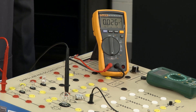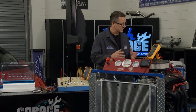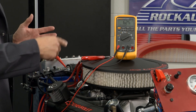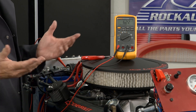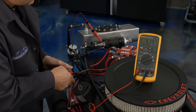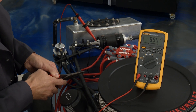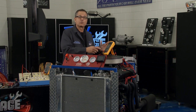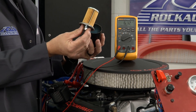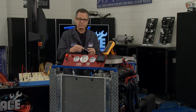If I reach down and try to stop that motor, it starts to make a higher amp draw. That's important when you start working on your car with components that have mechanical resistance. I can demonstrate it with this fuel pump. If I hook it up with my meter in series, the electrons are running through — we're looking at 6.24 amps, that's fine. But if I pinch this fuel line, watch that amp draw go up — it starts blinking on the meter, getting up to about 10 amps. That's heating up the component, causing problems, maybe premature failure. A clogged fuel filter will look like that and cause a massive amp draw.